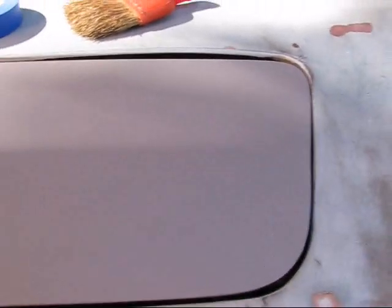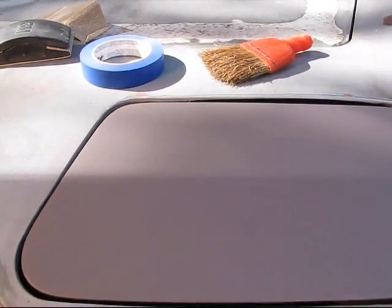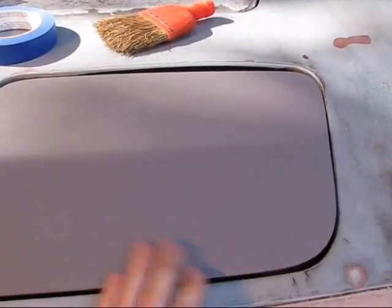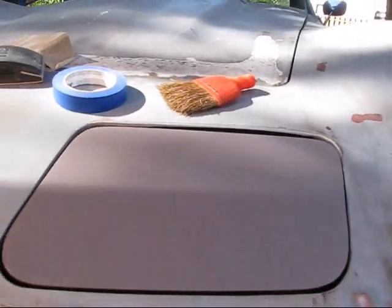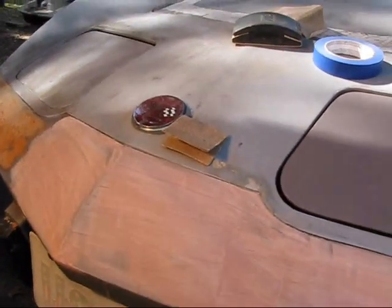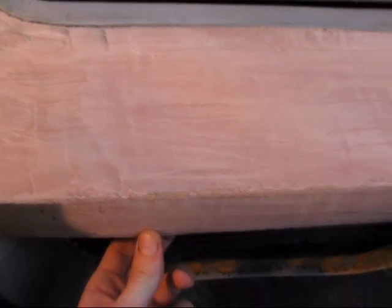I'm going to put some Bondo on the other side too. In the previous clip I talked about priming the headlight — I got it primed, wet sanded it, put a little old spot putty on it, then put some more primer on in a real thin coat just to make it one color. This piece here was sticking out so I just put a screw underneath into the rubber bumper behind it and that pulled it in nice — you can't tell it's there.